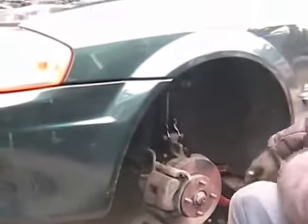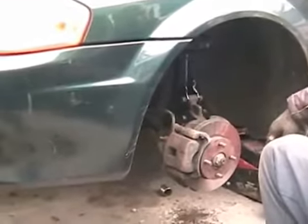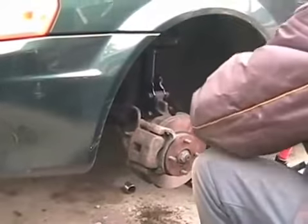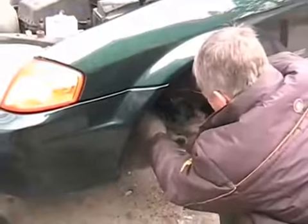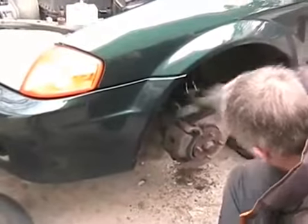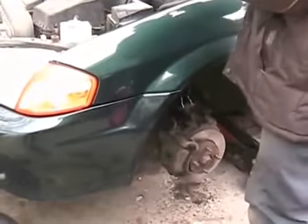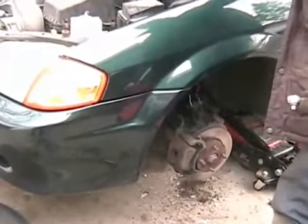Alrighty. Now this one is in a set position, so there's no adjustment on here. But many cars you have to kind of mark the position everything was in so that your alignment's correct afterwards. Well, we're lucky this time. I can just tighten it back up in any old way. Tap that clip on. Gotta put on my stabilizer link next. Tighten the bearing plate nuts. Pretty much all done. Simple as that.